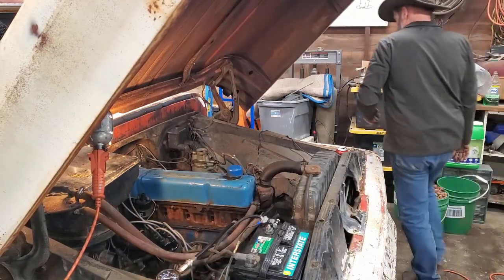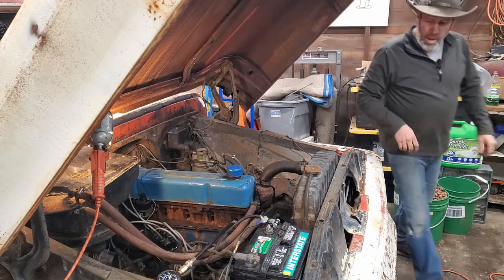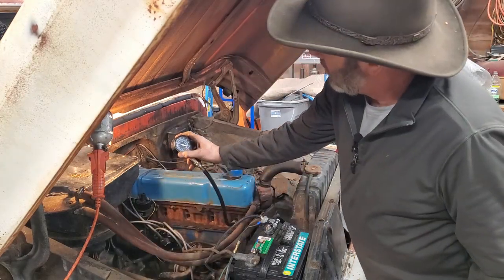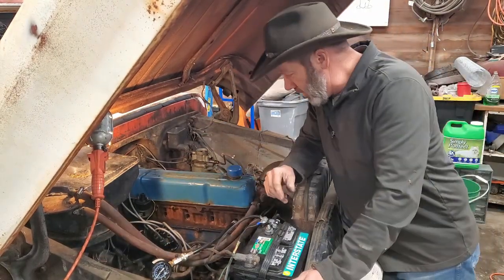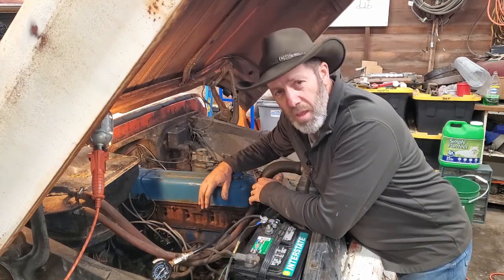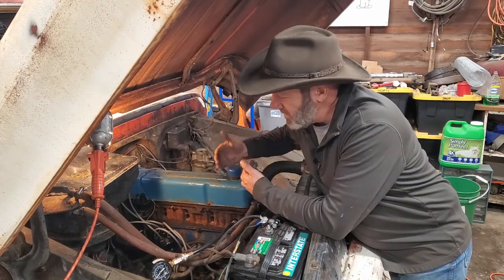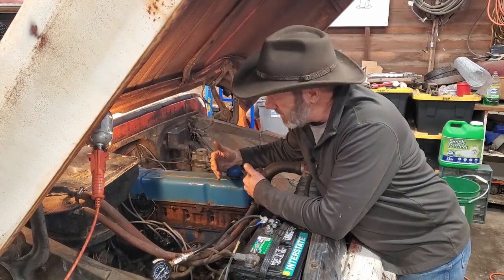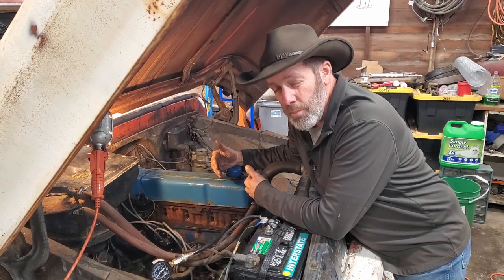Okay, let's give it a go. We were at about 110 PSI before, and now we're up to about 120. So what I'm going to do is not bore you with going through all six cylinders, but I'm going to do the same compression check on all six cylinders, write that down, and see how much variance I have from one cylinder to the next. The school of thought I've always been trained with is I should have about 10% variance.